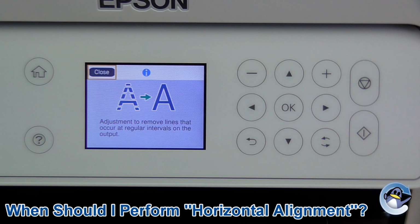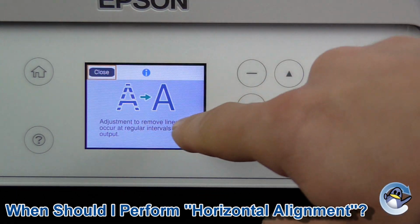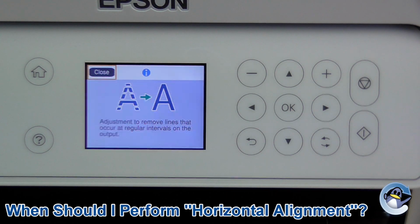If, however, you've got stripes running horizontally, you're going to want to go into horizontal alignment, which as again shown here, little breaks across your characters at fairly regular intervals. Now this can be misdiagnosed as a print quality issue, as you do sometimes get breaks in certain portions of the printhead. So if horizontal alignment doesn't fix this, you might want to look into running some cleaning cycles, which we also have a video for on our channel.